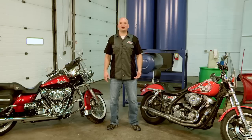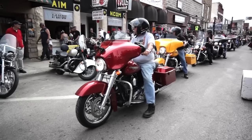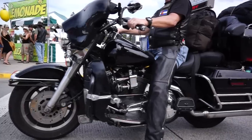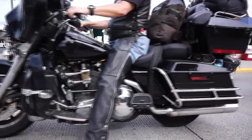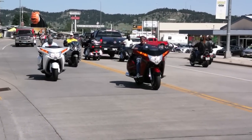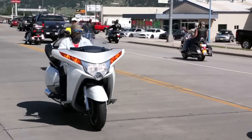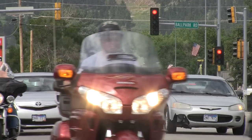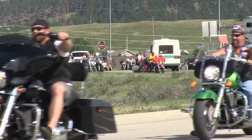Sometimes the riding situations that we put the bike into can cause the heat to do different things. Let's say we're in parade traffic, or a very slow speed situation where the RPMs are low and the speeds are low. There's not a lot of ability for the bike to cool itself in that situation, so heat can start to climb. A large bagger can have fairings, guards, and different covers that are going to keep the bike from cooling itself. The outside temperature can have a direct relation to the temperature of that motor. So the environment, the bike itself, and the situation we're putting it in can all have an effect on heat.